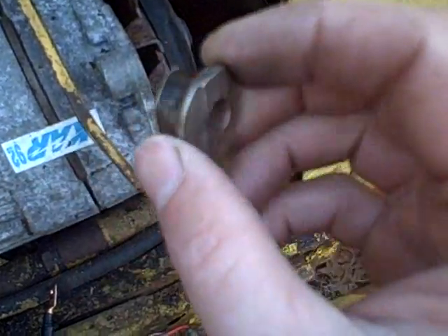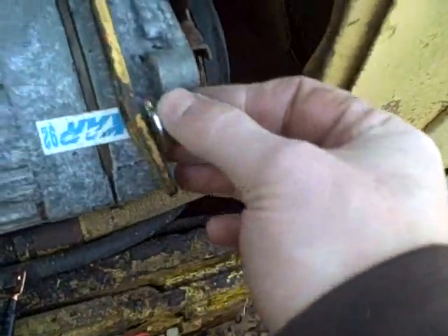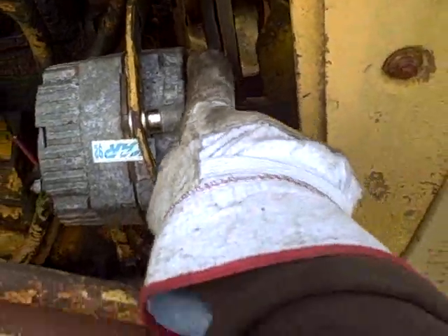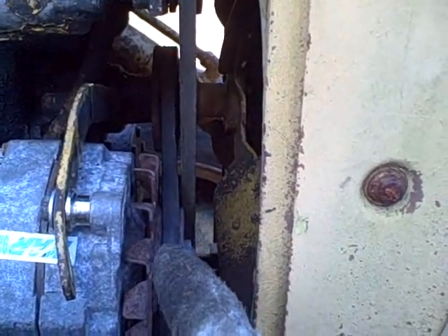Here's my little spacer - looks like this thing was solid brass, but it was scrap as far as I was concerned. Just realized I've got to put a washer underneath the head of this bolt. This isn't working - I don't like this alignment the way it's working out. When I tighten everything down, that belt is precariously close to hitting the fan blade. That whole alternator is out probably three-eighths to a half an inch too far forward.